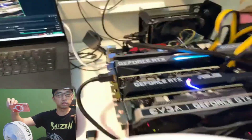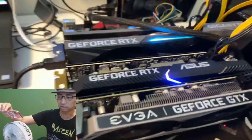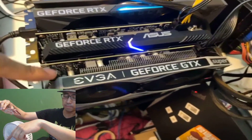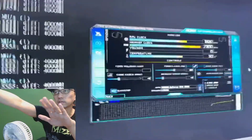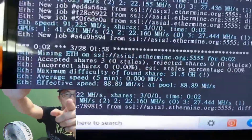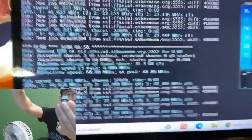We're back — I'm recording this on a second day because I had to wait for the HDMI dummy plugs to come in, to trick the second RTX 3060. I've already installed the second RTX 3060 in the second slot and kept the GTX 1660 Super in there. Without any overclocks, the 3060 is running at 41-something megahash, but the second 3060 is nerfed at 22.16 because I haven't plugged the dummy in yet.